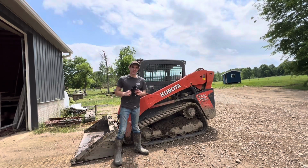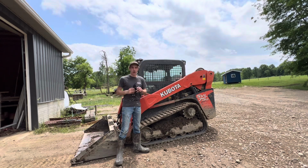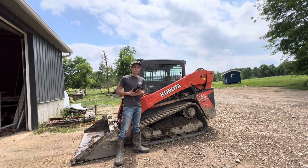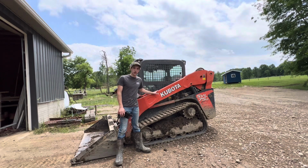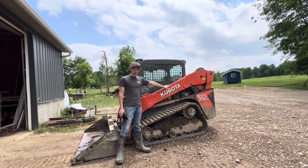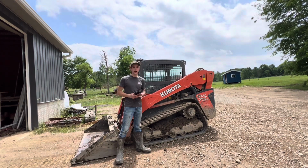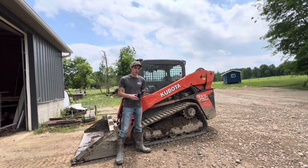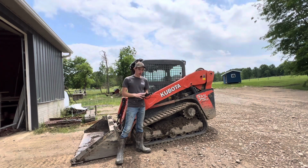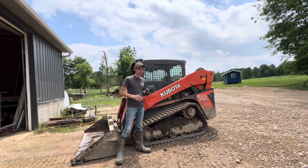Welcome to today's video. We're going to be bumping up the horsepower on my Kubota SVL75 over 100 horsepower with GPT tuning. So without further ado, let's jump into the video. You guys know we already did the DPF and EGR delete on this thing, so all that stuff's already been done. So now we're going to be tuning the software for that delete, because right now, obviously, with all those things deleted, there are error codes coming up on the dash, so we're going to get rid of all those and bump up the horsepower. We did performance tuning on here, so bump it up to over 105 horsepower with the DPF and EGR delete.